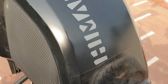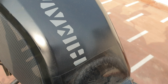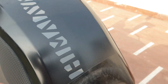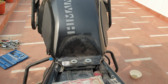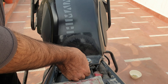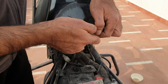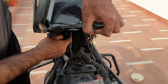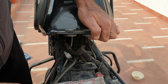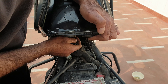There should be two hoses coming from this: one is for your drain — fuel excess drain or water drain — and the second one is for evap. Let's pull those out as well. Just pull the tank back slightly, then lift it. The bigger one should come off easily. The second one has a clamp on it, nothing major, but that should also come out.